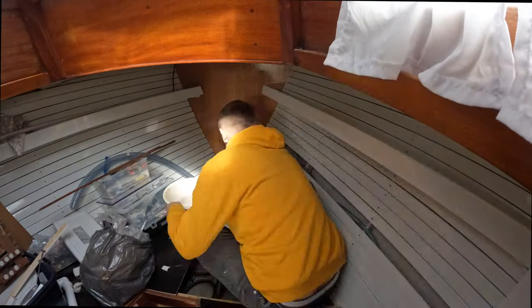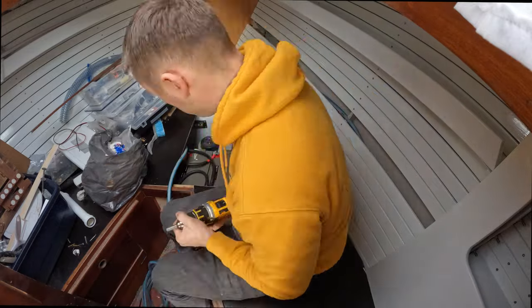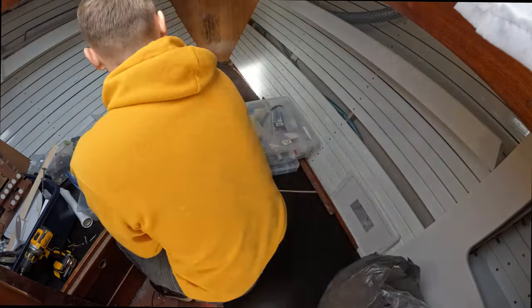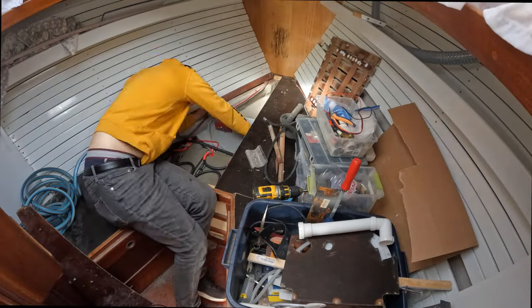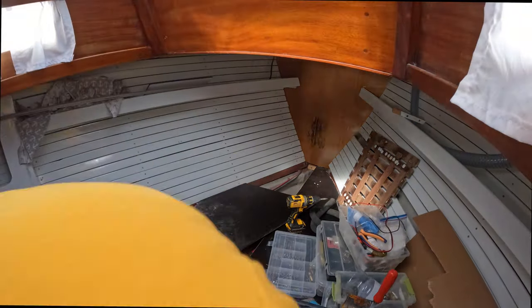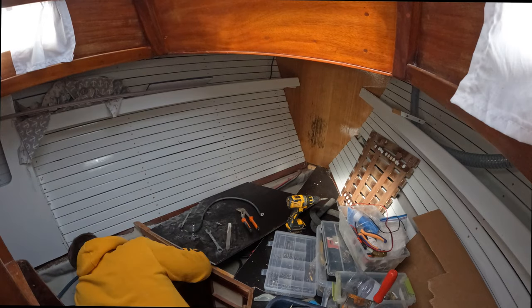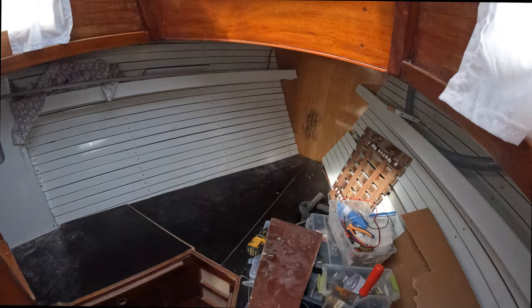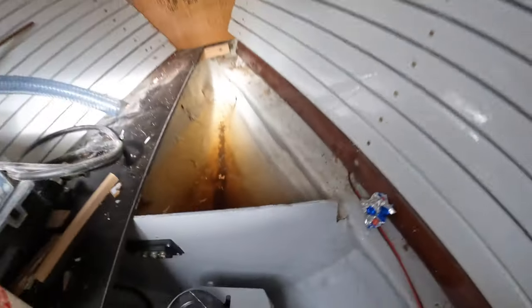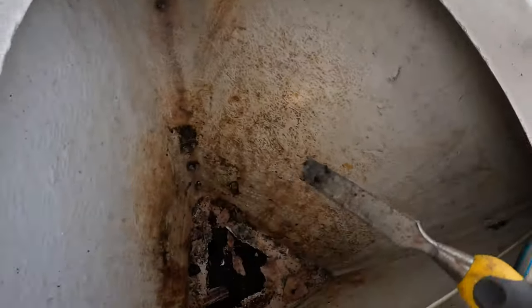While finishing some unfinished things in the V-berth I found another surprise — water trapped between the boat hull and the wall. I had been finding water under my floorboards, cleaning it, and the very next day there was water again. I turned around the whole boat trying to find the leak and just couldn't find it. Turns out it was so full it found a way inside the reinforcement that runs over the whole boat, and at the lowest point it dripped out. The only place it could come from was the chain locker.